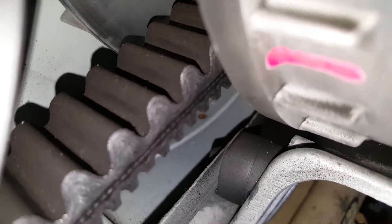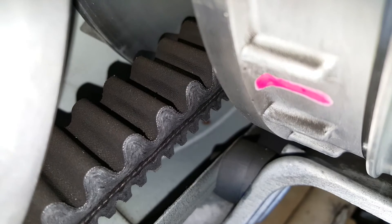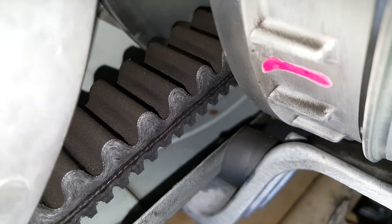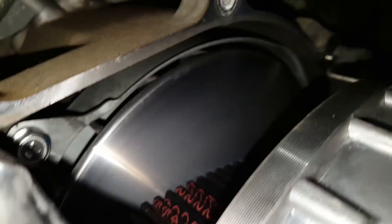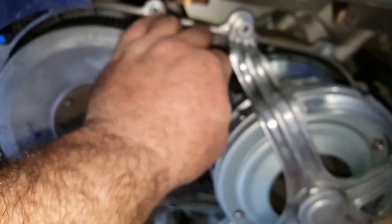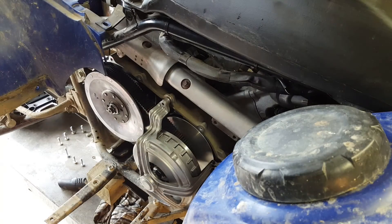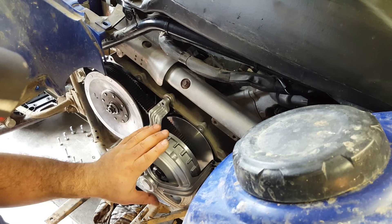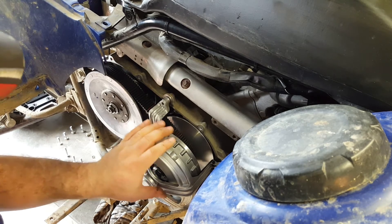So if you look in there, you can see that the belt is a little bit worn — we've just worked that out with the verniers. But other than that it's in really good condition and it doesn't give any indication of being burnt, and there's nothing that would indicate it's been slipping. The pulleys, the pulley surface, is very clean — it's not contaminated, there's no bluing of the metal which would indicate overheating. Very happy with that. It's got a good tension on the belt and the customer didn't mention any problems of the belt slipping. So we can now put it all back together again. The actual inspection process of the belt is pretty quick — it's the actual taking off and refitting of the cover that eats up all the labour time. Now if you need to change the belt, there's a bit more of a procedure involved, and we've got to take off this big support bracket here which supports the outer of the front pulley system.